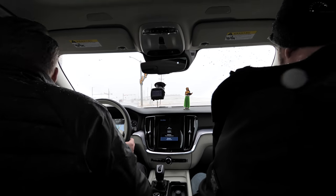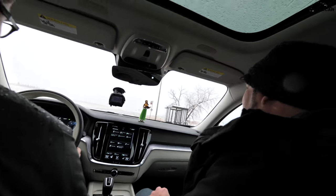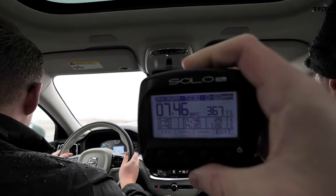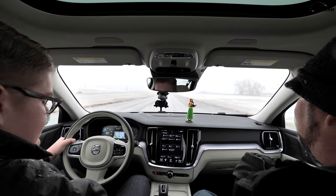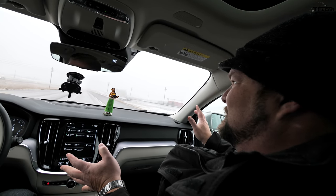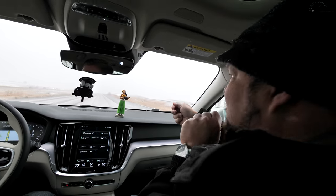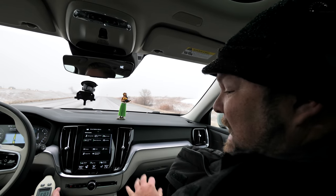We brake torqued it and went. It has a kick — picks right up. We checked and got 7.46 seconds — on a slight uphill, in very wet and snowy conditions, with three people. I'm impressed with that result. The cool thing about the twin charge engine: normally with old turbocharged Swedish cars you'd push down and wait for spool-up. With the twin charge, the supercharger kicks in first, then disconnects mechanically as the turbocharger takes over — it absolutely mitigates pretty much all turbo lag.